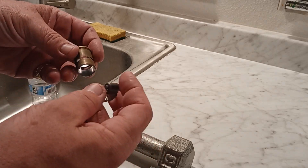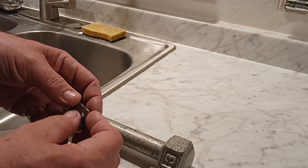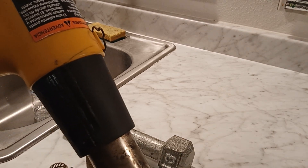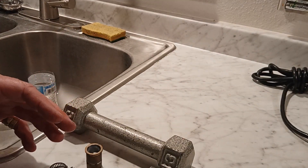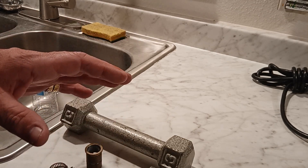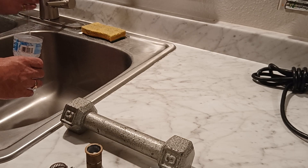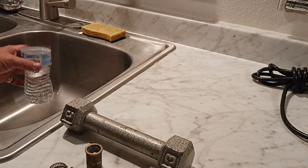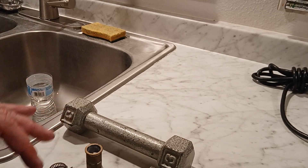I'm going to put a hose clamp on the sleeve and tighten it down. I'm then going to heat that with my heat gun right here. At the point that I feel like I have heated it enough, I will quench the sleeve in some cold water right here — and that's pretty much it. That is how I pinch my sleeves at home.